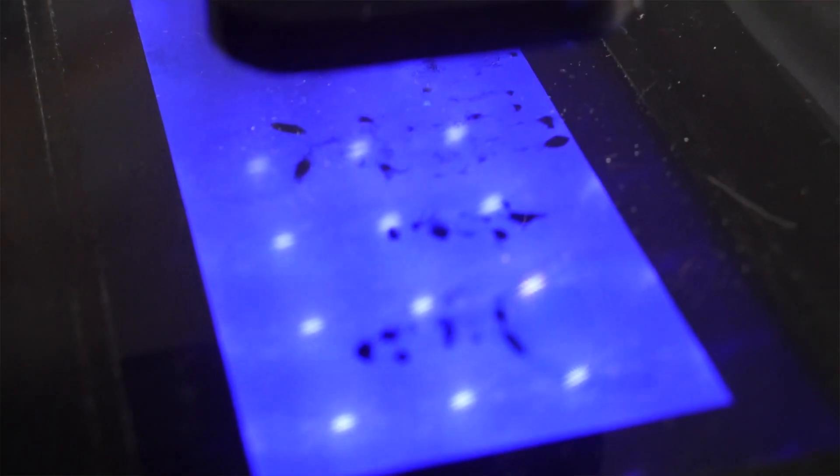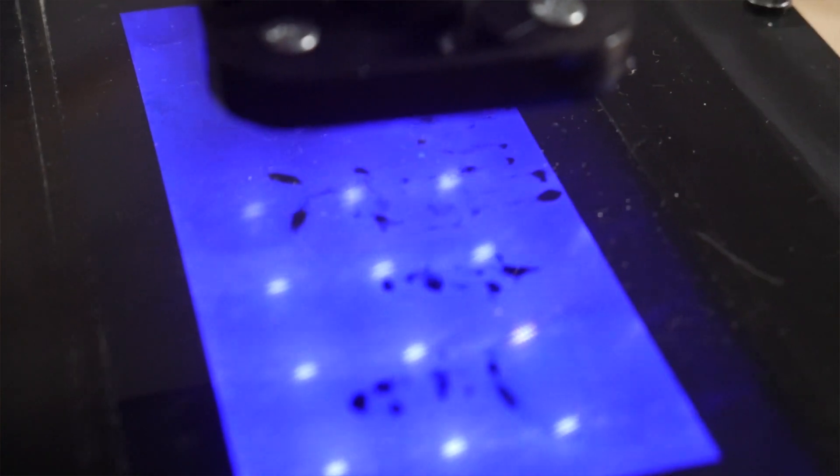And remember, this is in general a good practice for also preserving the life of the LCD screens, because if there's enough pressure placed on the LCD screen, it will cause one of the layers known as the lower polarizer on the screen to delaminate — that is, peel partially off of the rest of the screen — preventing the LCD from working properly, which translates into a black spot on your screen, also known by many as a dead pixel.